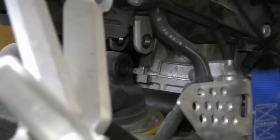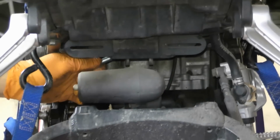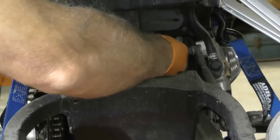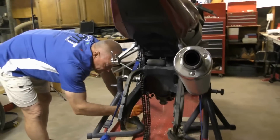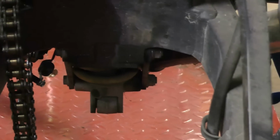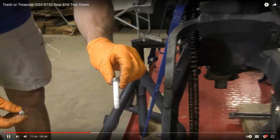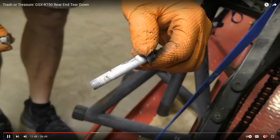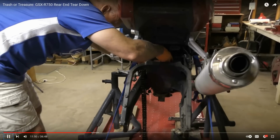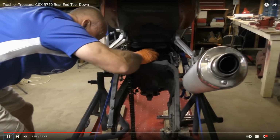There's a top bolt. Now go find the top nut. That's out. So we'll put the top bolt back in. Then we'll pull the bottom bolt. That's not had much lube on it, ever. Oh, from the factory. So, that's zinc. Now we can pull the shock. It's doing exactly what it's designed to do. Get out. Be an anode. Hopefully.